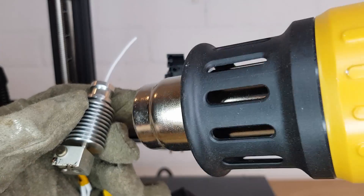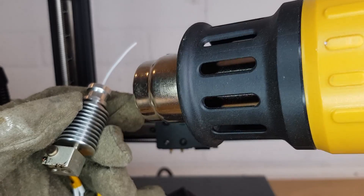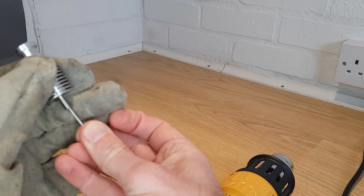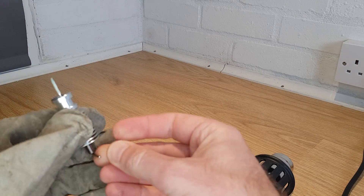If not, and if you do have a heat gun, use it to warm the top section of the heatsink until the filament does pull free. At some point the hotend will become hot enough for you to either pull the filament free or to push the blockage through with a small tool like an Allen key. This method worked for me on one occasion, but if you're still unable to completely clear your blockage then move on to the third method.